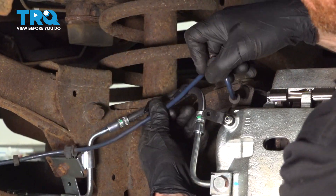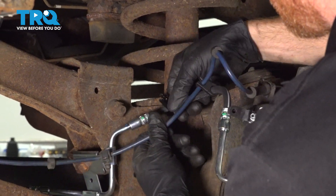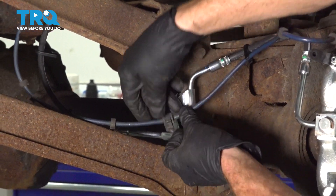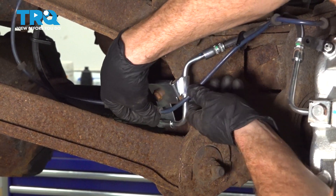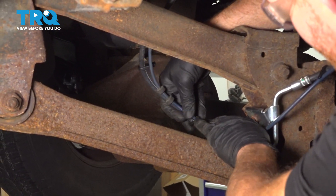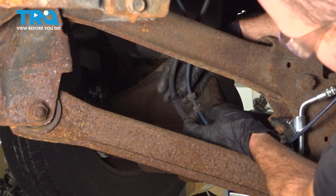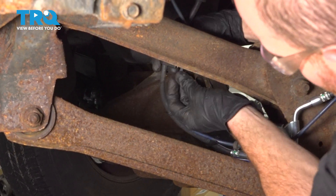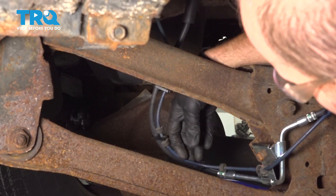Now it's time for our ABS wire. You want to make sure that you re-secure this so there's no way it gets damaged while you're driving down the road. We'll press this directly into each one of these two brackets along here, and then we'll make our way along the other side as well. This should go right into that bracket — we'll pull up any slack that we need. Make our way along the backside here. It's a pretty tight fit into these brackets, which is a good thing. Slide the remaining clips right in — last one's up a little higher. Double check to make sure everything's secured properly.